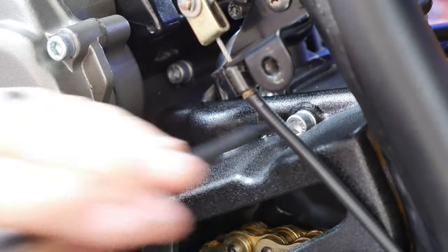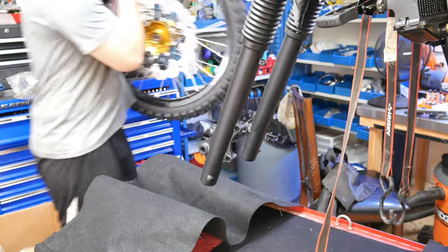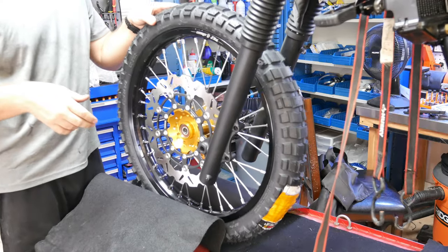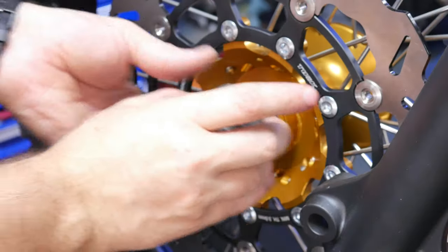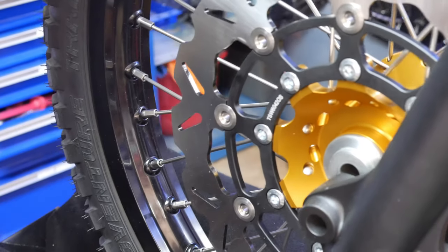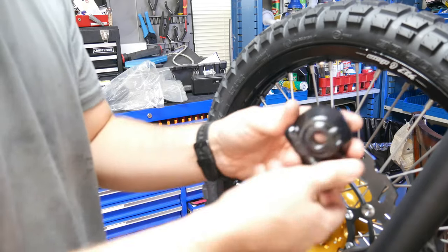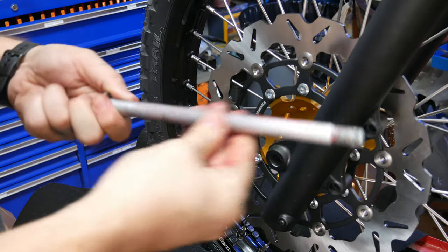That's it for the back drive and wheel — now on to the front. I wish there was an easy fork swap for the KLR because this wheel and this oversized rotor really make the forks look even smaller than they are, and they are small. No forgetting the spacers this time. For the front shaft, I was smart and kept everything on the shaft like it came off the bike, so that helped me not to forget anything. I've capped off the speedometer cable because I'll be using a Trail Tech to replace the stock speedometer cable, and I don't want dirt and grime getting in there.